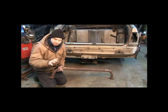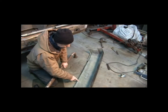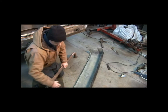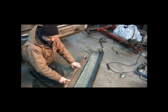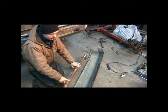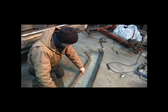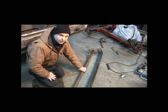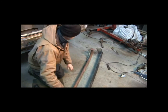Bear with me. Here is the bumper — as you can see, there's a ridge, it's basically on a circular curved pattern. What we've got here is the inch and three-quarter, .095 wall tubing — roll cage tubing that I use for the skid plate mount. If you take a look, it goes right in here and just fits flush. So there's very little amount of tabs.